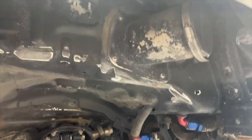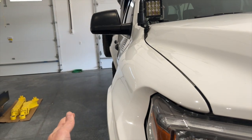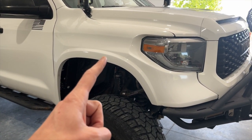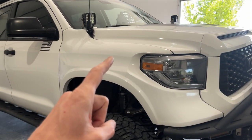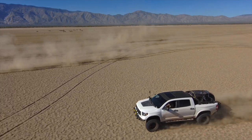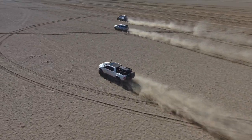Which brings us to the last component that has to change to make room for this kit — your fenders. These aren't the factory fenders; these are fiberglass. They bump four inches out on the side to allow clearance for that full travel of your tire to stuff. The downside is that the easiest answer for your air intake — a snorkel — every snorkel made for this truck is made for a standard fender, so normal snorkel kits won't work. You have to go with a custom snorkel. It's not a bad idea anyway, because if you're putting this kit on, it's probably because you want to go do high-speed desert stuff, and snorkels — as much as everyone thinks they're for water — are primarily for dust.